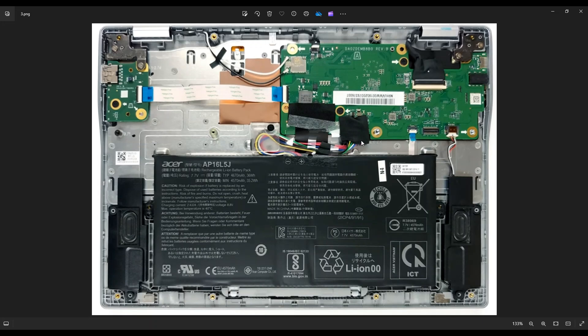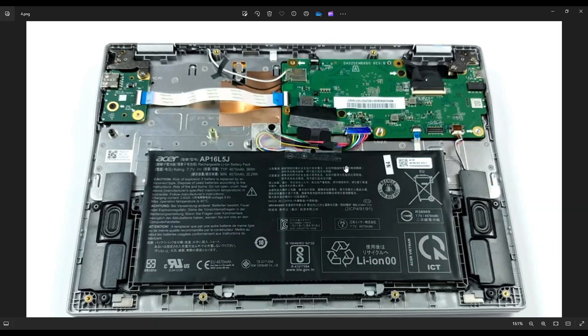It's kind of a pain. This is a black piece of tape — you can just peel that off. Once you do, you'll see this kind of plug that you can just unplug from the motherboard. As with most cords in a computer, try not to pull on the wires if you can help it. Try to manipulate the plug itself. You have a grip on either side — you can use your fingernails to pull that out or a pry tool. Don't pull on wires if you can help it.